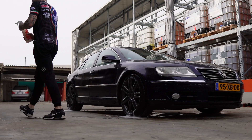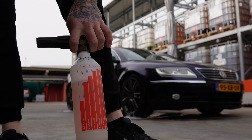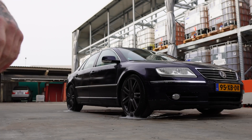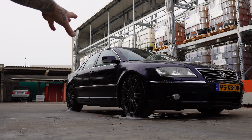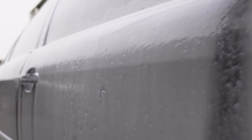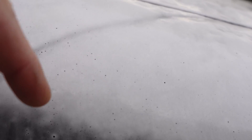I'm going to use the bottle of the pre-spray. I'm switching up the bottle — this is the amount of product I took. I'm going to use the rest of the 1 to 10 dilution to make a foam, so I pre-sprayed the car and let that soak. Adding the foam gives a double hit — the top of the car is less dirty than the side, so a little less chemical power on the top, a little more on the side. I opened up the valve because I want a curtain — you can see this extremely thin layer of foam, and even the dividing line of where the dirt is versus the less dirty part.